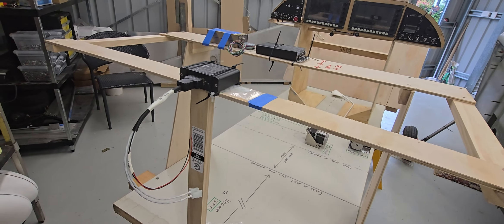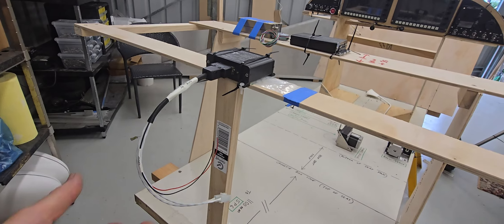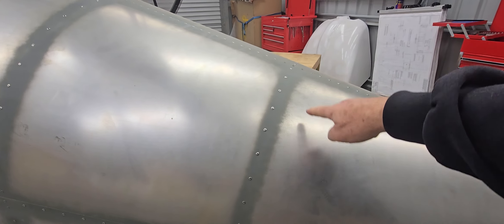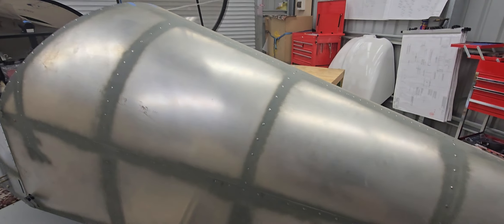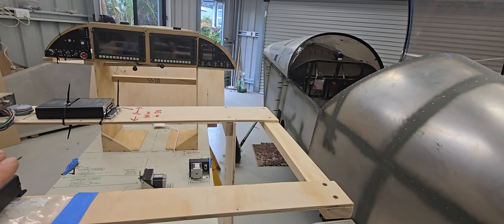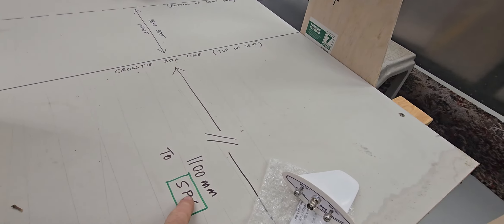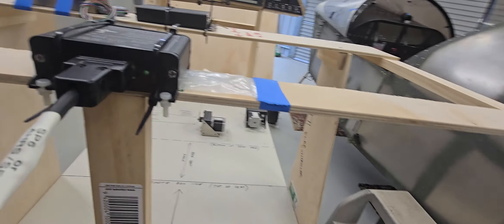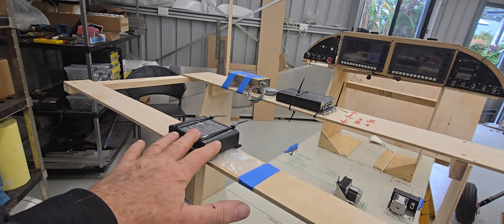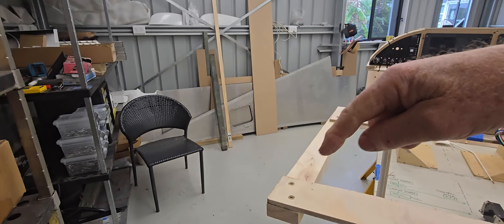Working our way through, I've got the SP6 here with the ready-made harness from MGL. This line through here is consistent with this line of the actual aircraft. Even though this doesn't match dimensionally, if I line the two cockpits up, I know this has to go an extra 1,100 millimeters out. When it comes to measuring the cable runs, all I've done for this part of the jig is to allow myself a route which I'll follow.